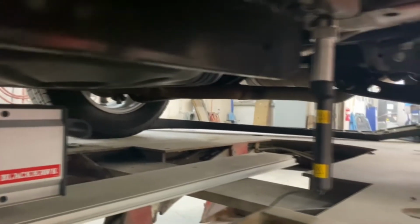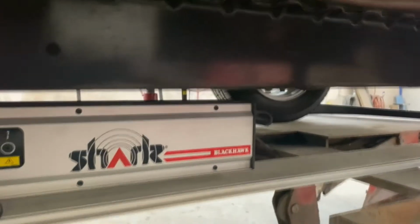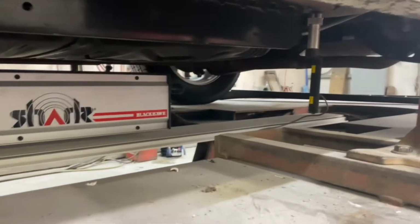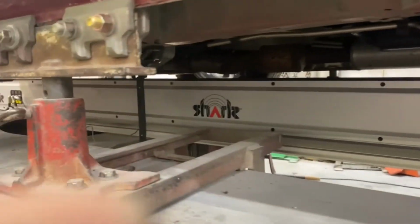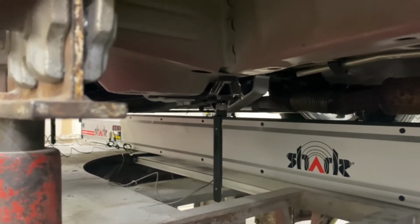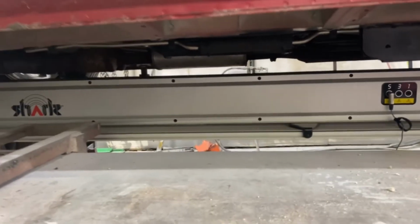There's a probe, and if you look at the probe, you'll see a little dot flash, and then the microphones on the beam hear that and know exactly where the end of that probe is at. So I set up 4 control points, torque box area preferably. Remember the cradle bolts in the front, and the rear ones are into the frame rail. Okay. And then I did a quick measurement on it, and the computer set them as control points.